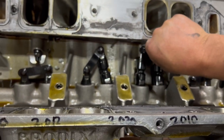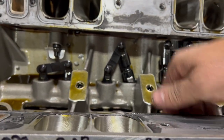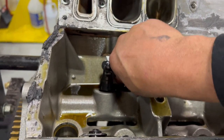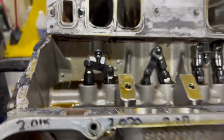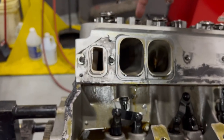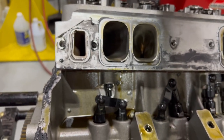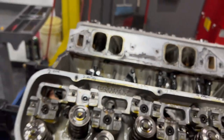Those are fine, fine, fine — but this one exhaust is morphed up, which is pretty common. It probably blew that wheel up. The piston came up unconnected to the rod — or the rod unconnected to the crankshaft — hits the valves, rocker arm tries pushing into it, and blows the wheel up. Very common.